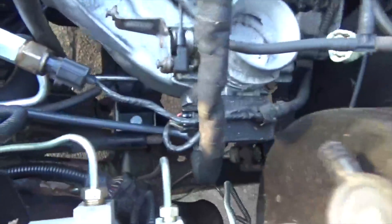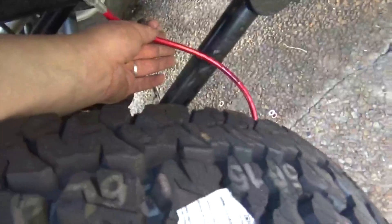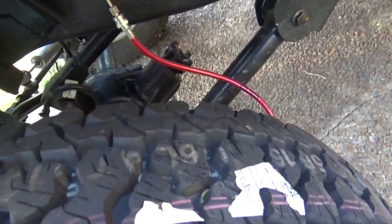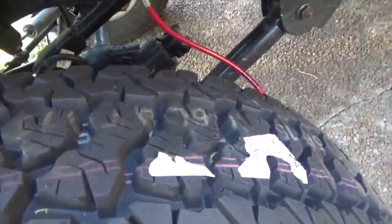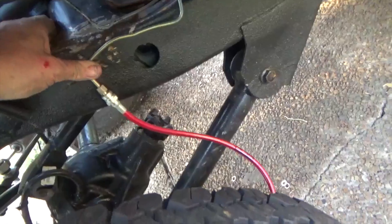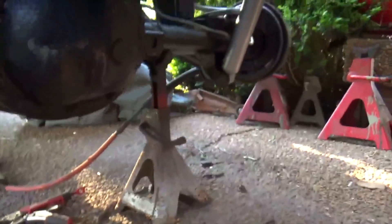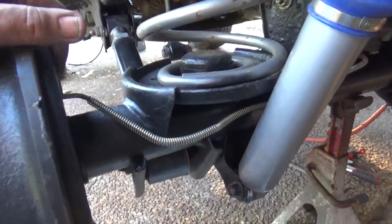I've got the brake lines running. You can see them coming off the master cylinder here — they go around the front to the other side and going down. I've got my two rubber lines; I'm going to have to get a hole drilled here. That's the rear line, but I'm going to have to fashion a clamp to hold these in place. Got the rear lines installed, going across both sides. Basically we're ready to start bleeding. Since Randy's here, he can sit inside and keep pumping the brakes — maybe two or three thousand times.